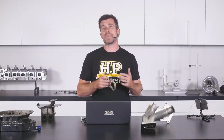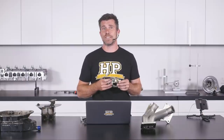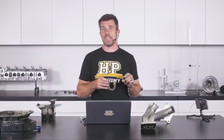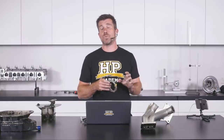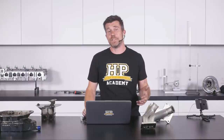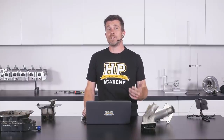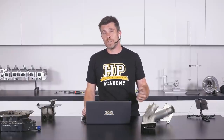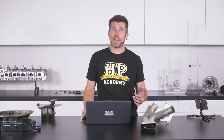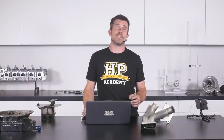What we do find is when we've got the individual cylinder lambda perfectly even across all four cylinders, we actually still see some variation in EGT. There are a lot of aspects that can affect the specific exhaust gas temperature value — one of them is the distance from the exhaust valve, and we want to make sure that's the same for all of our EGT sensors. We also want to make sure the sensor is protruding the same distance into the runner. On the rotary engine, given that they run very very hot, it's going to be a very harsh environment for lambda sensors to live in, whereas the EGT sensors are a little bit more hardy.